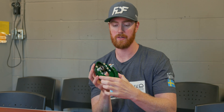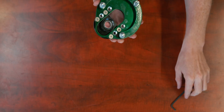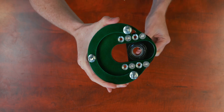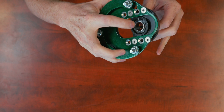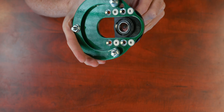To begin, I want to address a common misconception. This piece here — we call it a horseshoe, or whatever you want to call it — this is not a brace to go on top of the strut tower. This is a spacer to allow for clearance to your coilover underneath the strut tower. As your coilover comes up through here, it usually has a knob, spacers, a nut, and all these other things, so you need a certain amount of clearance for that.